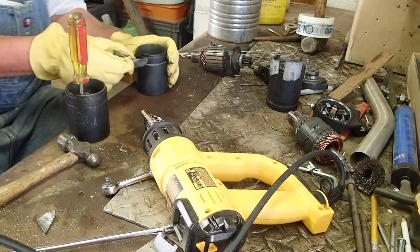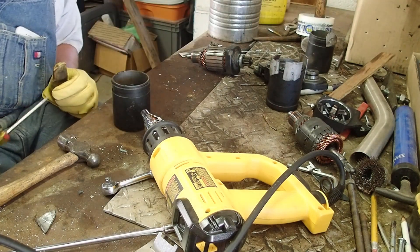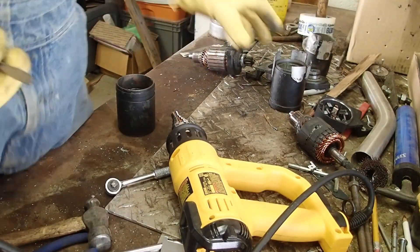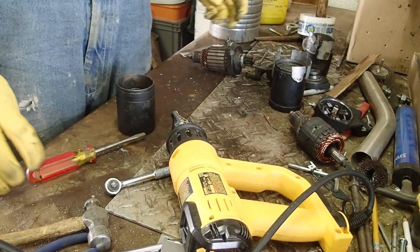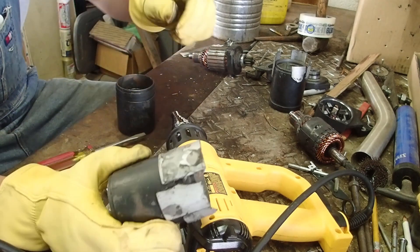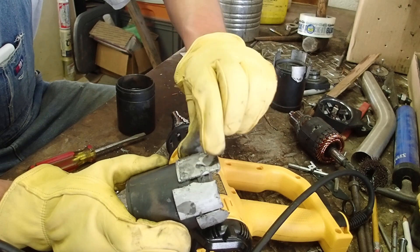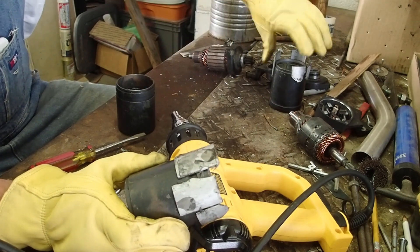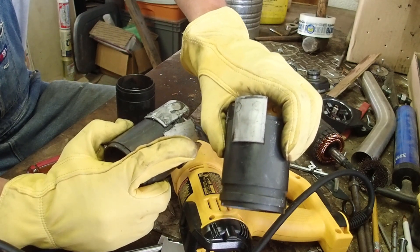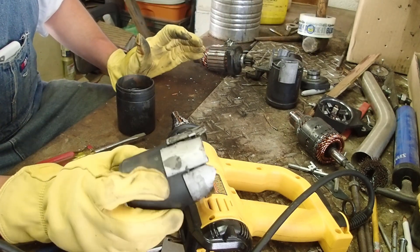This one came out like this, so I'm just going to keep the orientation correct. There's another broken one in here. I got everything loose — and it smells like super glue. This is what came out of this starter that was sent to me. See that layer of film? That is not supposed to be there. It should come out looking clean with just dots where they put the glue on originally. Someone tried to super glue this — maybe it's Gorilla Glue. I got everything loose out of this starter also.